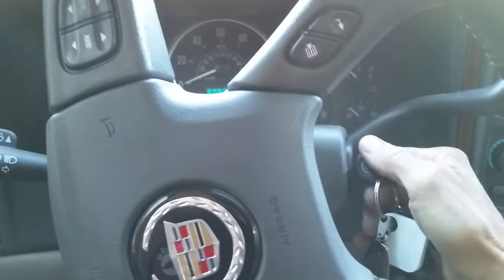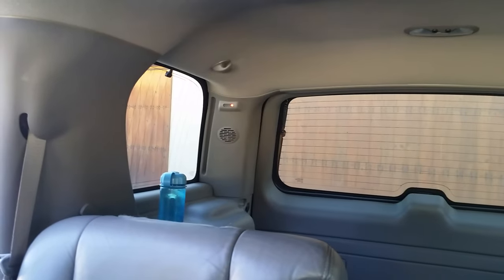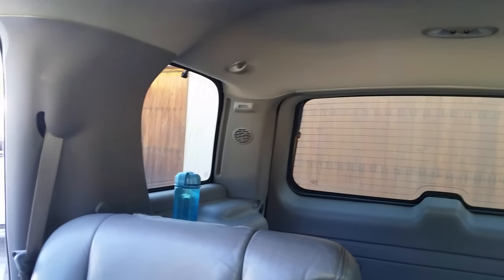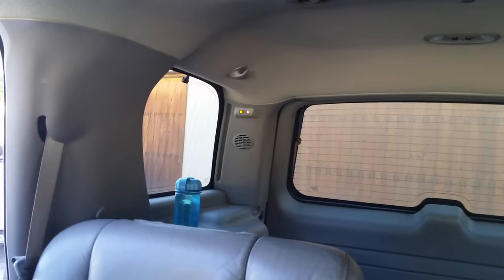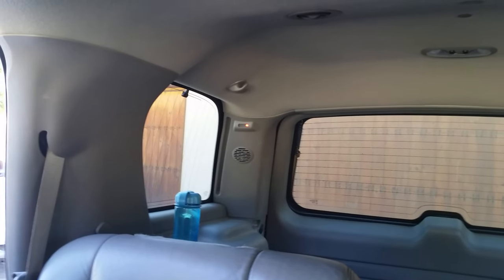So let's start the car, put the ignition on, put it into reverse, and now look back at your lights. You'll see two of them on the outside blinking, and then you'll see the one that's faulty blinking. The two outside ones indicate we're in diagnostic mode.